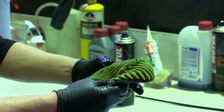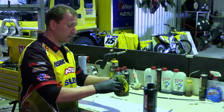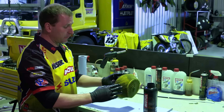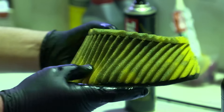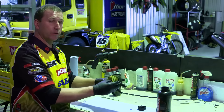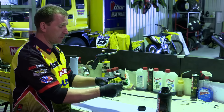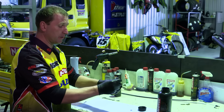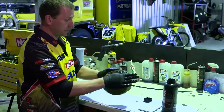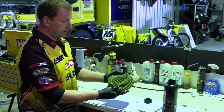Don't wring the air filter — you're basically stretching all the pores in the air filter itself. Just by squeezing through, you can actually see areas that will still remain yellow and green, so you do need more air filter oil in those areas. Keep pouring that filter oil into the inside so it moves through to the outside. If you oil the outside of the air filter it tends to struggle to get through, but this way you're actually squeezing it out. Make sure you've got it all in there, massage it in, and you're good to go.